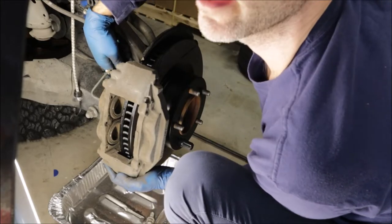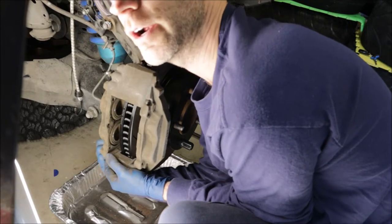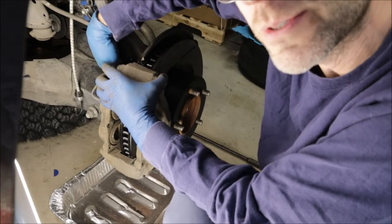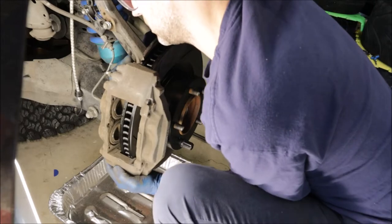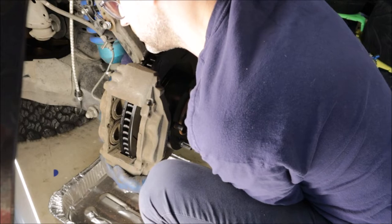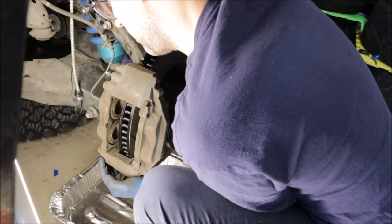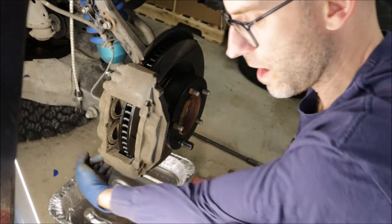Don't force anything. Check your factory service manual for proper torque specs — not only is it supposed to be like that, but you're actually saving yourself — or the next person — a lot of headache when they go to do this job. Looking at the pads and rotors, it looks like it was a Toyota job, and you can tell. These things weren't blasted off with impact guns; they weren't impossible to get off. A little extra effort goes a long way — if not now, maybe later.